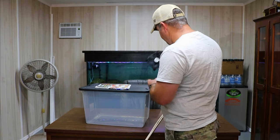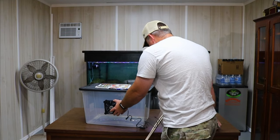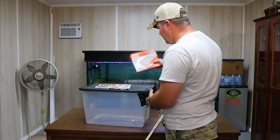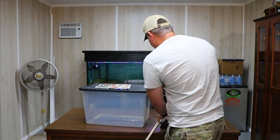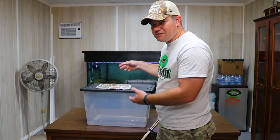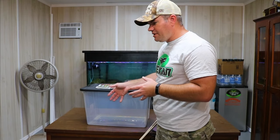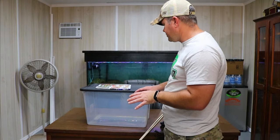What we're going to do is you have a fan on one side, pulling the air out of the box, and you're going to have your filter on the other side, filtering the air that's coming through. That way, no dog hair, cat hair, dust, bugs, none of that stuff comes in here. So if you had a fan on here and a big hole on the other side, you're still defeating the purpose. By sticking that car air filter in there, you're letting air come through, but nothing else, keeping the clear coat nice and pristine.